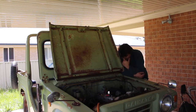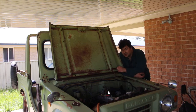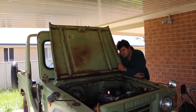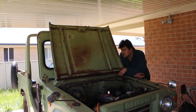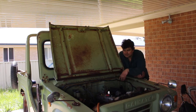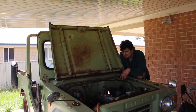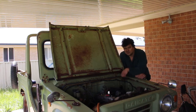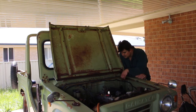We're probably gonna call this an episode. I know it's been a while, but I'll keep pottering around. I'll probably have to order the sheet to continue on. I've still got the rust repairs to do in the driver and passenger floor pans where it comes down for the floor sheet to sit on. I can probably cut that out of that roof skin. If not, I'm gonna order a full sheet of 1.2mm and I'll just fold it up at work — it's just flat with 90s, pretty easy.